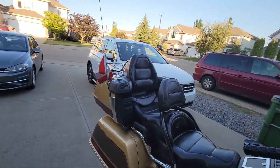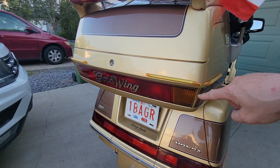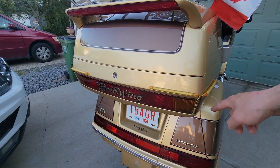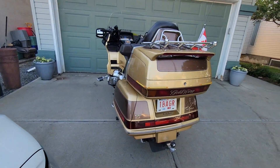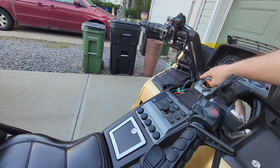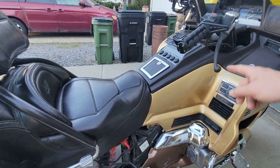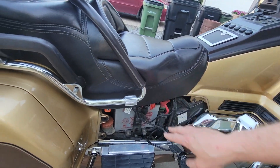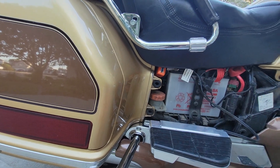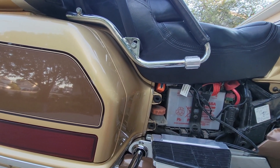On the rear of the bike, I ran the wires inside the trunk. The only place you see a wire on the back is here, then LEDs on each side and on the back — the original Goldwing signals wrap around so someone on the side can see you. Running the wires from the switch, they come down, split to go to each side of the lights, and split to go to each side of the horn, because there are dual horns down there. The wires ran underneath the stereo console under the seat. One thing you need to remember for something like this, besides hooking it up to the battery, is having a flasher. The flasher came with the signal switch and has a little screw inside that you turn left or right to speed up or slow down how fast the lights flash.